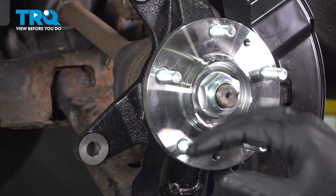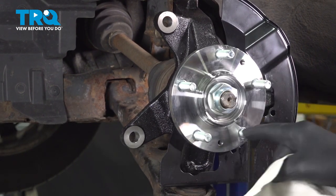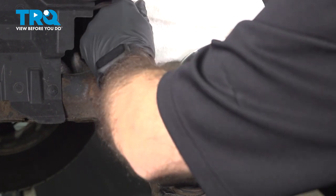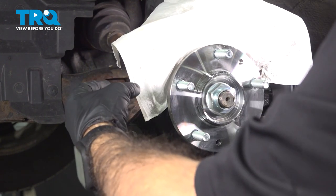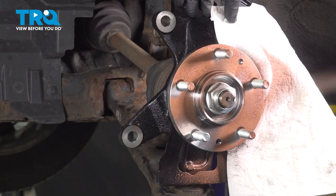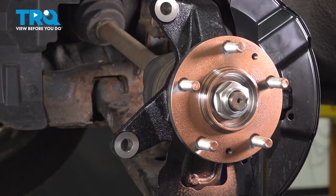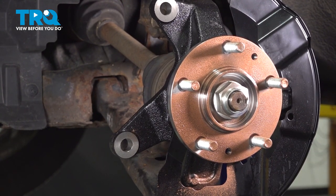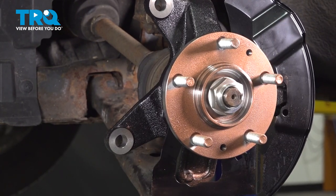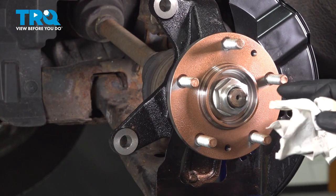For us, this is extremely clean — it's now free of any greases and oils. What we're going to do is put some anti-seize on this surface. Because we're going to use anti-seize in an aerosol form, I'm just going to cover up the areas it does not need to be on. Just give it a nice light coat. If you did get a little bit of overspray, not a huge deal — you can come back and wipe it up. Mainly you don't want this to be anywhere where your stopping is going to happen, like on the inside of your brake pads. A little overspray on the backing plate is okay. We'll let this dry up and then we'll put our rotor on.